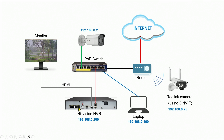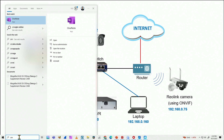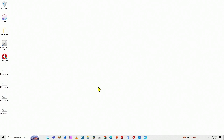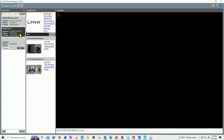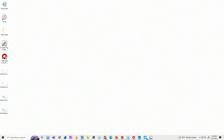It's working with Reolink, and back here to the diagram I just need to make sure the ONVIF is working, so I can use an application like the ONVIF Device Manager. That's the ONVIF Device Manager — it's a free software and this software can find cameras on the network. To make sure your camera is working with ONVIF, you can just use this software. Here we go — I have the Reolink camera visible via the ONVIF Device Manager. As long as you have this, you are completely sure that it works with ONVIF. That's the protocol to work with these cameras.